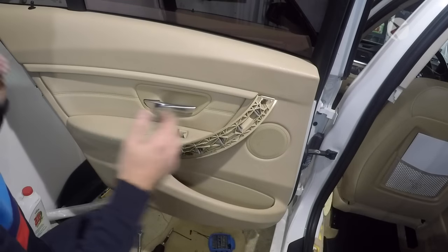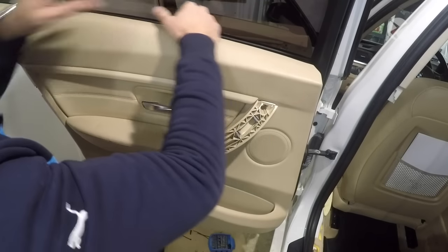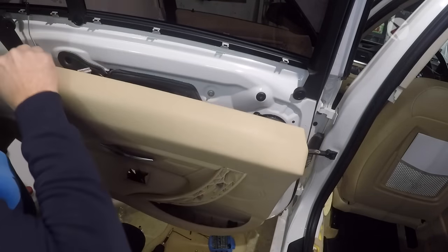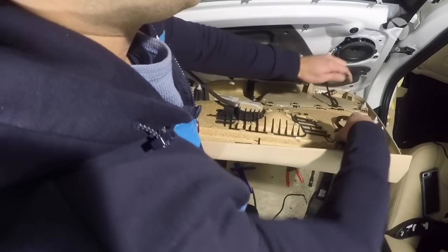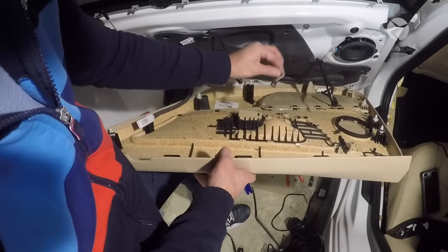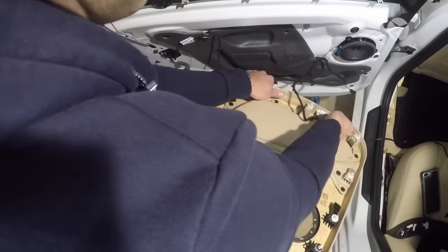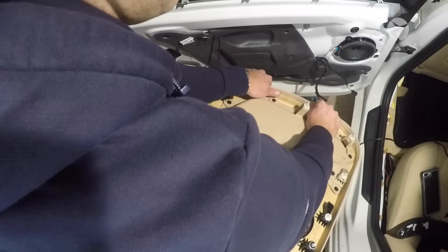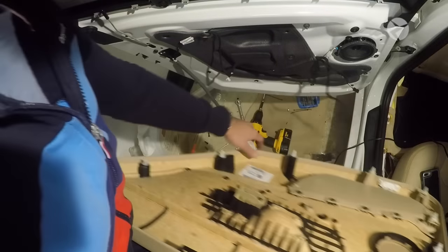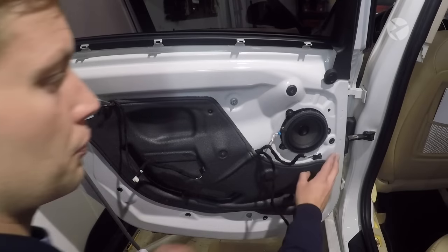The same as last time — instead of lifting up, pull it straight out. That way everything stays intact and don't worry about this because it will bend with it. Go ahead and disconnect the door light, remove the latch, pull this out, and this is for the window switch if you haven't done that already. Go ahead and remove the puddle light, then place your door panel to the side. We need to remove this foam to be able to work — just carefully pull it down.